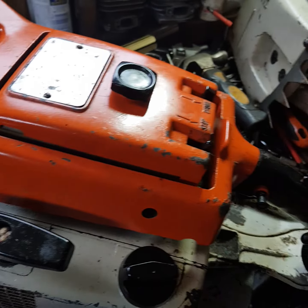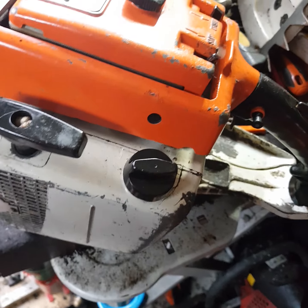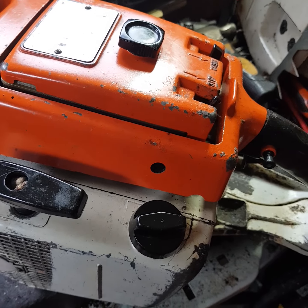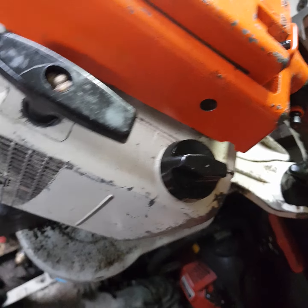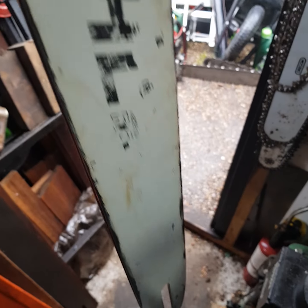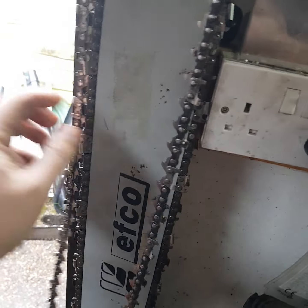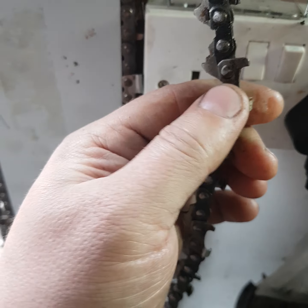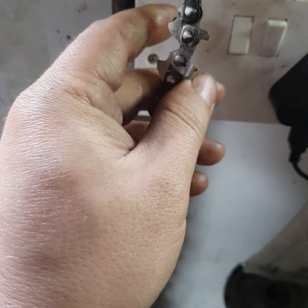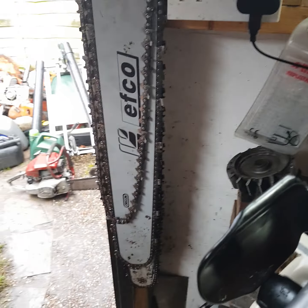They don't leave any room for improvement, they don't leave anything for the operator to think about. And yeah, so I'll start the saw, see how nicely it ticks over, nicely runs. I have a 24 inch bar and chain, 404 for this one. The chain is round ground, doesn't matter, honestly. It's not sharp, it's kind of sharp, but someone just didn't know how to. I have chain for it. That's not a problem.